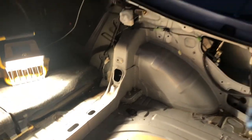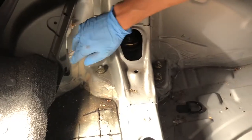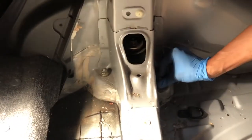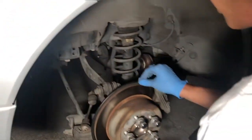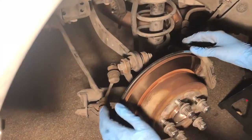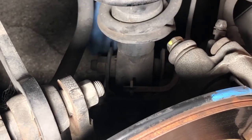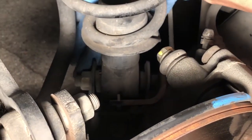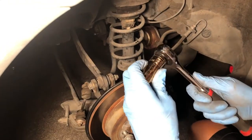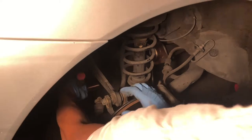We need to remove the interior plastics to get to these two bolts and one behind them — three bolts in total holding the rear coilovers. For the rears, the only bottom bolt we need is this one. Take out this nut — the other end is a bolt that should come out — and the nut underneath there is a 19, so go ahead and unbolt that.